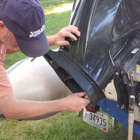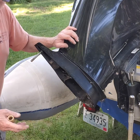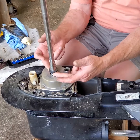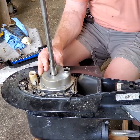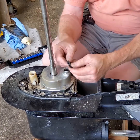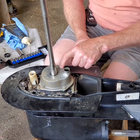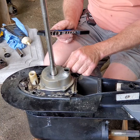There's a plastic bushing in here — you want to make sure you don't lose that. A lot of sand, so this boat definitely was beached several times. First thing I wanted to show you is this slinger — this is the piece that prevents sand from going down inside the impeller. It is extremely dry rotted, there's all kinds of debris wrapped around it. This pump has not been changed in a long time, so I suspect the impeller is probably damaged.